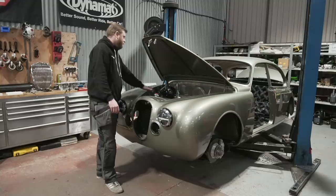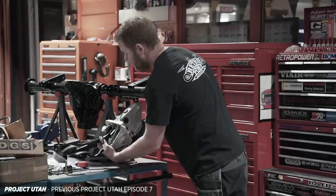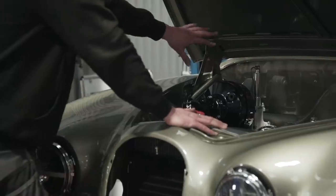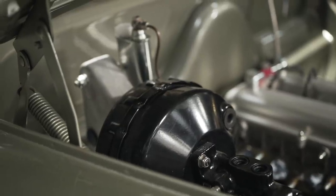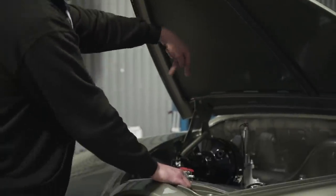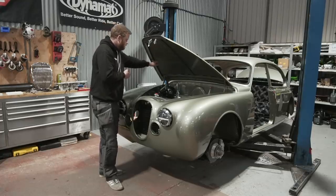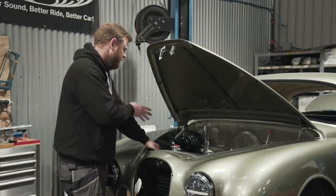In the engine bay, the brake and clutch plumbing - we're using a Jag X300 pedal box from a manual transmission version, so it has a hydraulic clutch. We wanted to make this look a little more classic. There used to be a round plastic reservoir. We spotted that the original Mark II Jag clutch master cylinder has exactly the same bolt spacing. The push rod is a different length, but we've retrofitted a Mark II Jag clutch reservoir and master cylinder into that X300 box, then changed the push rod so it works with the X300 pedal - and that looks really in keeping.